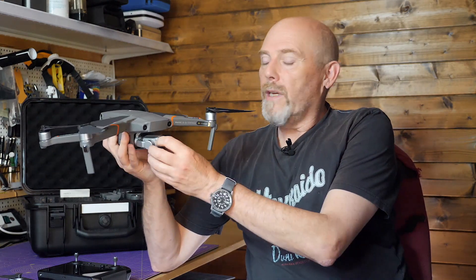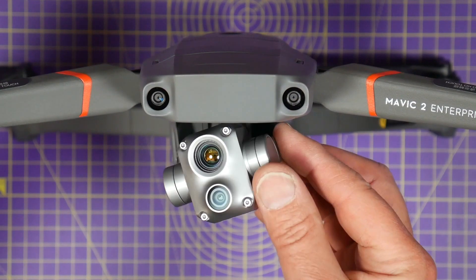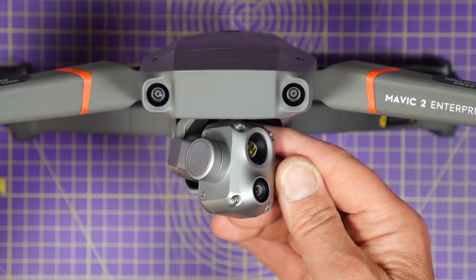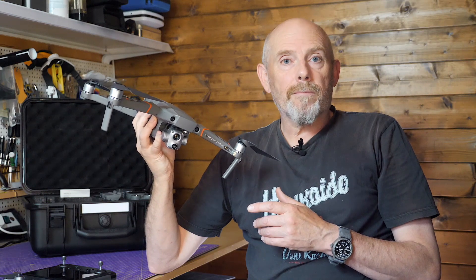If you've been searching YouTube to find out if the Mavic 2 Enterprise Advanced is any good, you'll have found loads showing it's great — zoom, thermal image and video features, and lots of 'wow, it's great' content. And it is: what this drone does is incredible. The RGB and IR camera sensors have a great spec. You get a half-inch 48-megapixel camera with four times lossless optical zoom, 32 times digital zoom, and a radiometric thermal IR sensor with 640 by 512 pixel resolution, 2 degrees C accuracy, 16 times zoom, and 30 Hz refresh rate. There's also an RTK option you can bolt on. Impressive specs — but they only tell you what it does, not what it doesn't do.